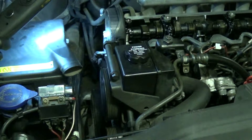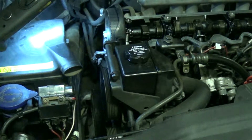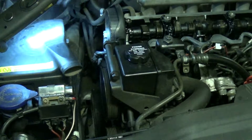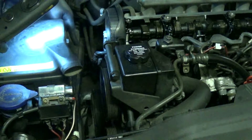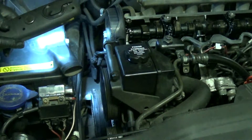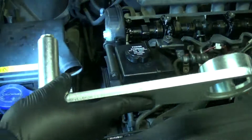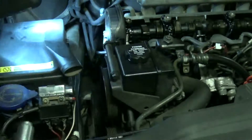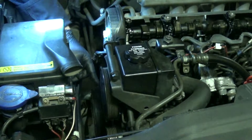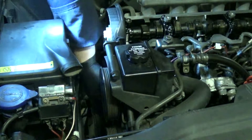What we need to do now is tighten the four bolts that secure the harmonic balancer to the inner timing belt sprocket. The second task is to tighten the centre bolt in the harmonic balancer. That bolt is legendarily tight and you need the Volvo tool that I showed you in a previous video in order to get that done correctly and safely.